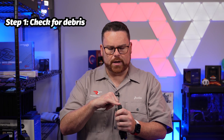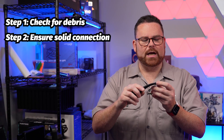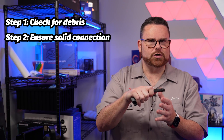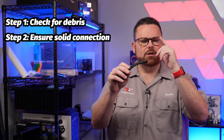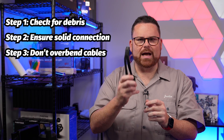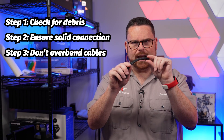Very simply: number one, when you get your connector, make sure there's no debris — just check the connections and make sure there's nothing inside. Then, once you're done with cable management, make sure it's securely plugged in. Don't unseat and reseat it; just make sure it's pushed all the way in. That'll fix 99.9% of issues. To be extra safe on the O11 Dynamic, don't use the stock cable — buy another cable that has a better bend without the bulkiness.